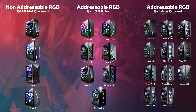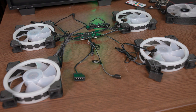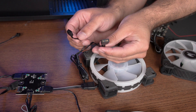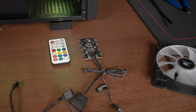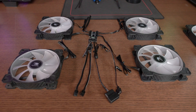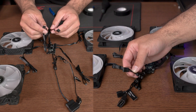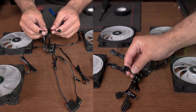Let's start with the older cases, as these have a much higher chance of coming disconnected. We have removed the entire RGB system from this case to show you how all of these parts are connected together. There is a central hub that distributes lighting to each of the fans, and sometimes parts of the case itself. The fan motors are individually powered, so each fan has two wires coming out of it. Newer iBuyPower cases come with a more consolidated RGB solution where both the RGB signal and the fan motor are combined into a single cable leading to the central hub.